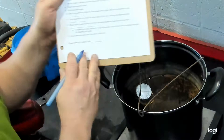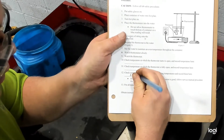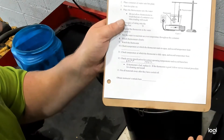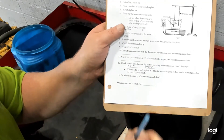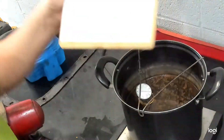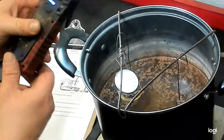I'm going to turn on the pot at this point and we'll keep an eye on the temperature. On the job sheet you want to write down the specifications. We have a 180-degree Fahrenheit start-to-open for the thermostat on the left and 190-degree Fahrenheit start-to-open for the thermostat on the right. We're going to be checking two things as we test these: start to open and fully open. Since we're testing two thermostats we will get four results total. It's very helpful to have a flashlight so you can see any changes in the thermostat.